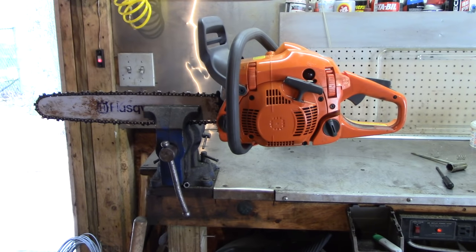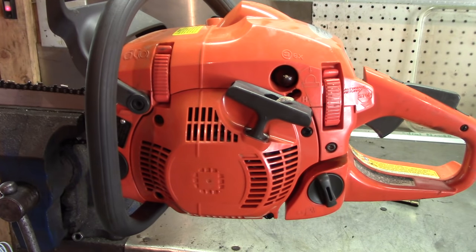Hey, John here again. So this is a little residential Husqvarna — might be an 18-inch bar — that's a little guy. I got this dropped off; the customer says it doesn't start, so I just went through the motions and of course it started. I want to make a quick video on how to adjust your carburetor if it's out of whack, because I had a feeling that's what it was — he said it ran fine and now he couldn't start it. I blew it out and cleaned it up a little bit; it was not even really dirty compared to some chainsaws.